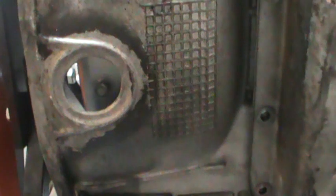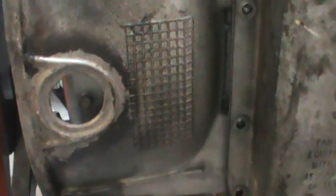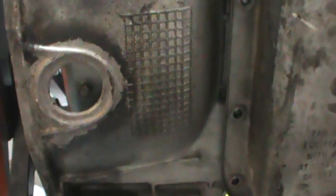Another nice feature on these Fords — the torque converter usually has a drain plug where you can pull that plug and drain the fluid out of the torque converter. That really makes it nice when you're doing a fluid change and you want to get as much fluid out of the transmission as possible, short of running it through the cooler lines and pumping old fluid out and fresh fluid in. If you're just doing a pan removal and filter change and you want to drain all the fluids out, using that plug on the torque converter will get roughly 12–13 quarts out, including what's in the pan. You can then flush the cooler out with some cooler flush or fresh fluid and it works out pretty well.